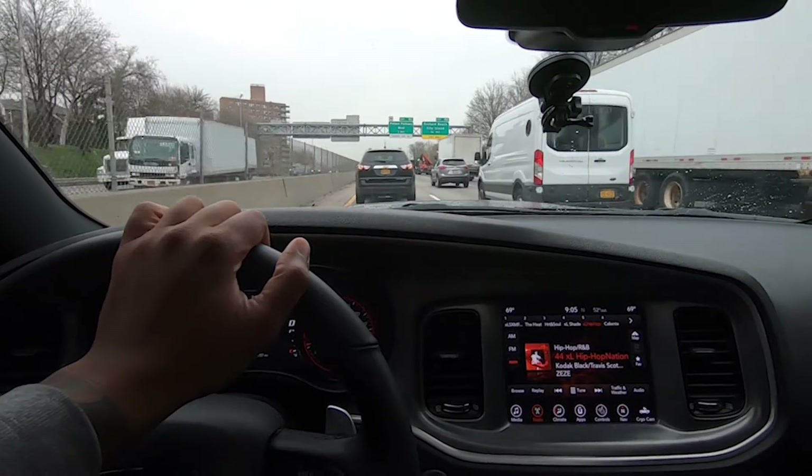They're great guys and we rely on them a lot. Sometimes I'll tell them a customer is coming tomorrow to pick up a car and they need new wheels put on — they'll get it done just like that. Raj has a history of tuning cars — he actually just got a Supra in midnight black, mostly stock but with some work done. Ram also has a Supra with Lamborghini doors. They explained that the semi-metallic pads are a bit heavier, which wears into the rotors and creates a little lip at the edge. When you put new pads on, you've got to get new rotors or you'll get a shimmy or vibration at high speed.